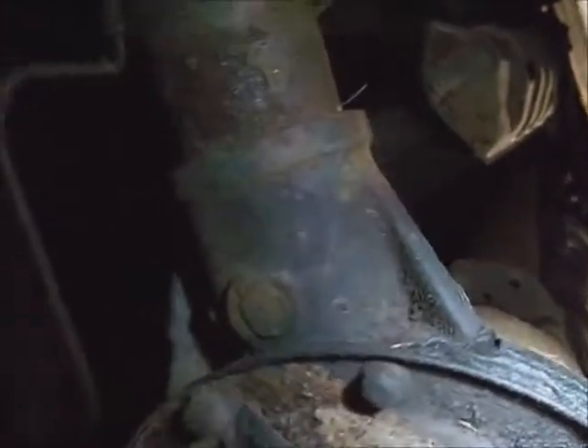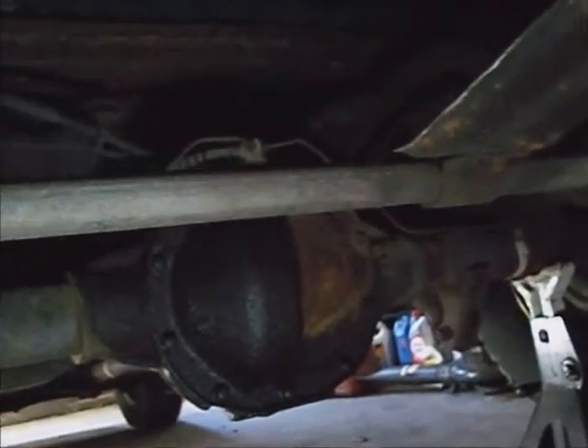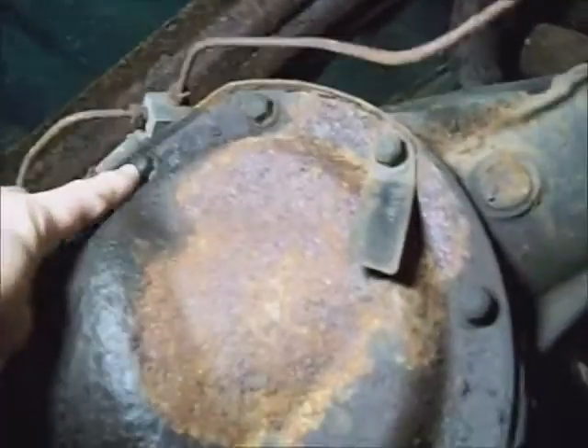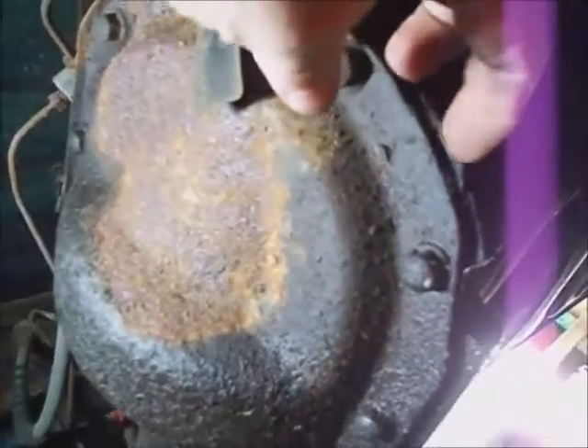It's time to take the cover off. If the gears aren't damaged I'll just overhaul it; if they are I'll have to find a whole rear end. I'm going to go ahead and take the rear end cover off and set a drain pan underneath it to catch the grease, if any is left in this one. There's a series of 13mm headed bolts holding the cover on. I'll leave the center one on top halfway in just in case the cover won't fall off — I think it's siliconed on, so it might put up a fight.